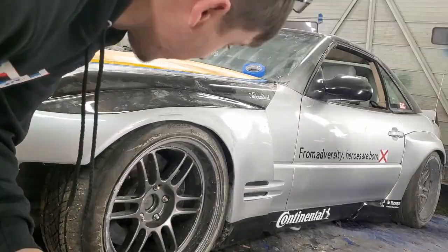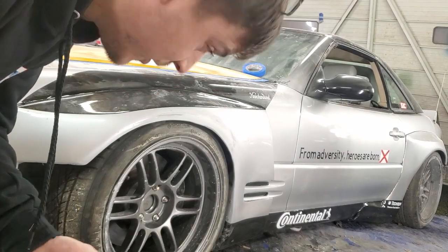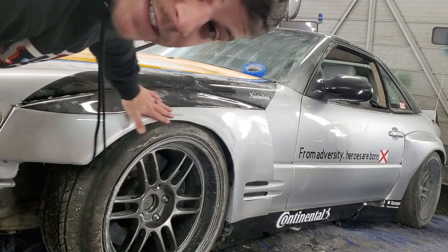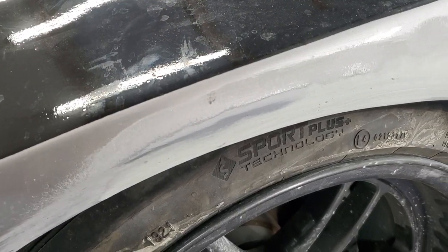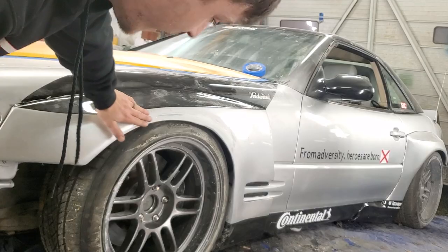I wanted to show you guys this process because I know a lot of you like to see this. So we broke our car, and you notice I already fixed it. The fender we just fixed the same way as the mirrors. We carved our channel, put in some fiberglass, put in some fiberglass filler, and then smoothed that out.